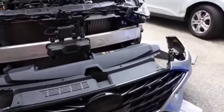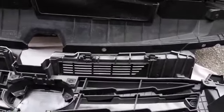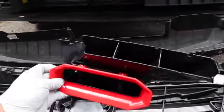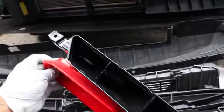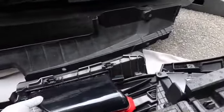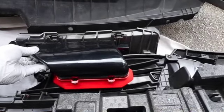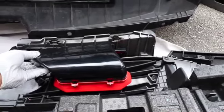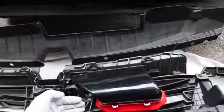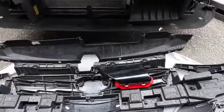That, we had the front bumper off. So here's the back of the place where we have to mount the Velossa big mouth at. You see there's a hole there, there's a hole here that we have to measure. And then it's gonna be mounted just like that. You screw the two holes in and then mount it, and then we're done. That's gonna provide the air straight through, up, and into the air box through the factory ram air.